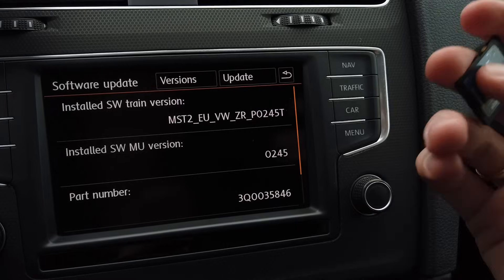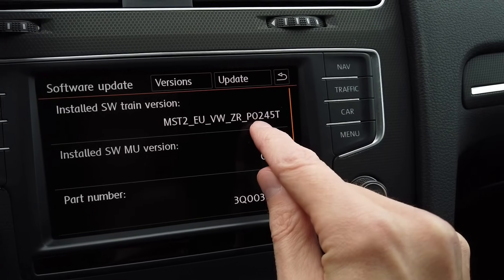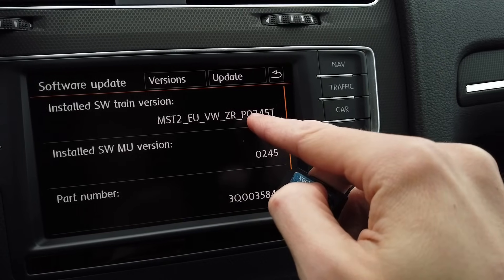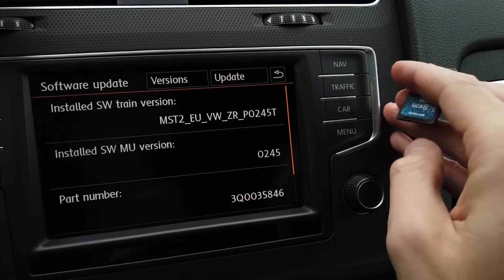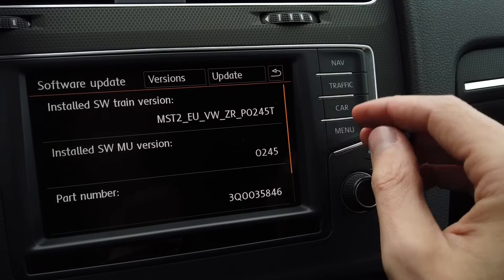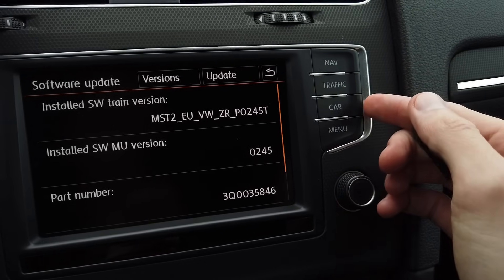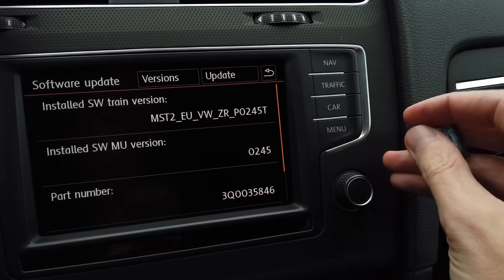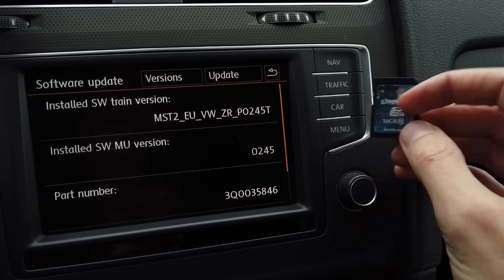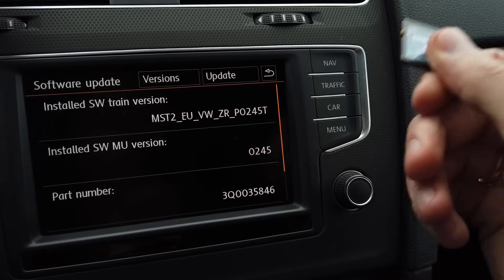For Technisat it's also important to check the first two numbers. There are also firmwares starting with O3 and O4 but those will not be accepted by the unit by default — there are ways to install them but this video is not about that. So by default this unit will only take firmware updates that start with O2, and the highest one starting with O2 is O2 0254, which is exactly what's on this SD card and what we are going to install.